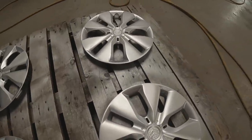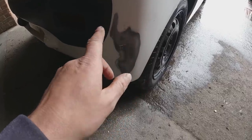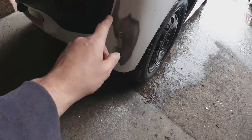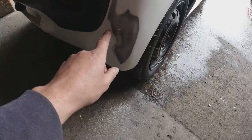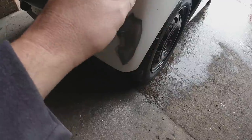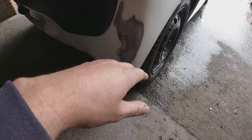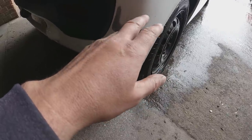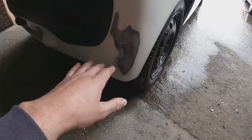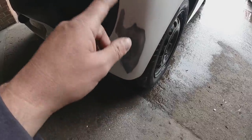Bright wet coat — last coat for the trims, looking alright so far. Now onto a scuff on the rear bumper. It appears it was just bad paint that started to flake a little bit. I've really feathered out the edges, done 400 and 800, taking it out about here. You don't need a huge amount of blending room because the white is a bit easier to blend, and we're not using a separate lacquer and colour — just a ready-mix 1K lacquer and colour together.